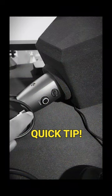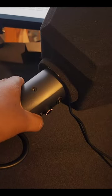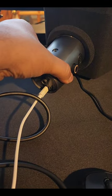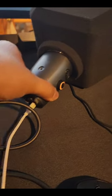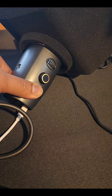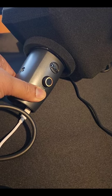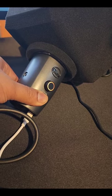If your microphone is not recognized by device manager in DFU mode, try the following two-button technique a few times — that's what I had to do before mine showed up. Press the front button that's lit up in yellow or orange and the back button simultaneously. Press and hold both, then while holding, pull the USB out. Wait 30 seconds, then plug it back in. It will flash red slowly at first, then speed up, then return to yellow. If it's then noticed by your PC, you're in good shape — if not, move to the next step.